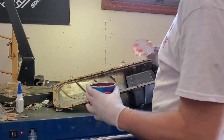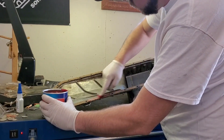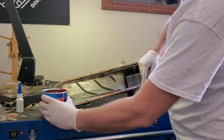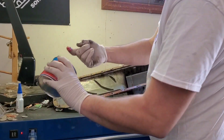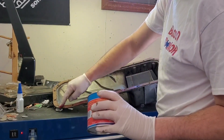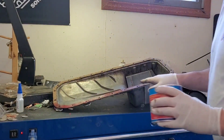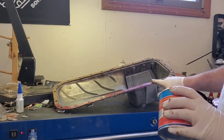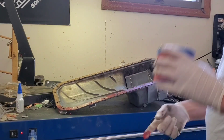We got cherry flavor today. You don't have to go crazy — just smear a good layer across all of it. This is a really common practice with people that race. If you've got a race car with a pushrod engine and you have to get in there and change your valve lash all the time with solid cams, you're probably going to take a cork gasket, glue it to your valve cover, and then coat the bottom of it in grease like that. That way you can put it on, it's going to seal well, but as soon as you take those bolts loose it's going to want to lift right up since it's just greased on there. A little tech tip for you.